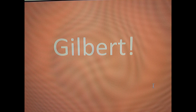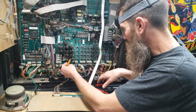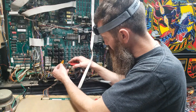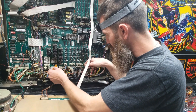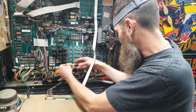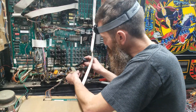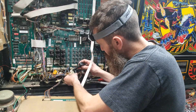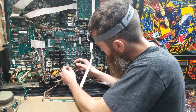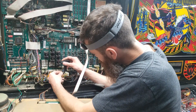This tool right here — you've got to have this tool. I'll put a link in the description for you. On your old connector, just snip off the wire. You'll make sure that it is arranged in the proper order — you don't want to mess your circuits up. Then you take your tool and line it up with the hole that you're getting ready to sink. This tool is gonna push the wire down inside of this housing. You get your wire straight, and you don't have to strip it — just leave the insulation on — and it goes through this hole.